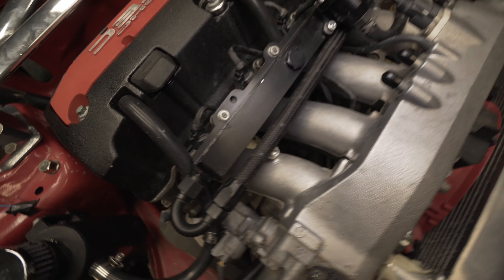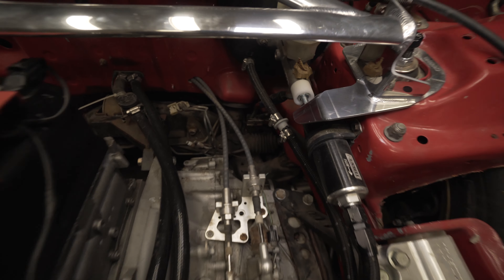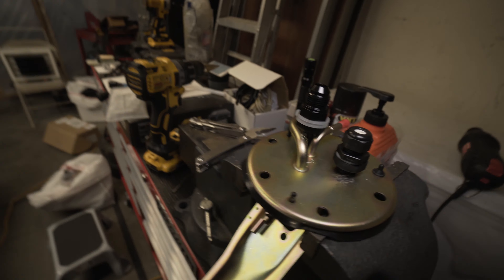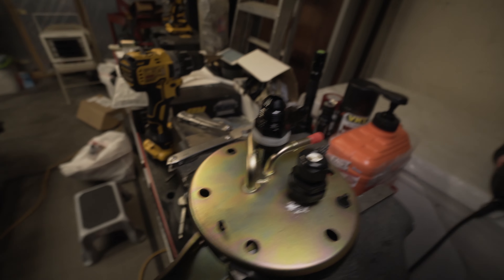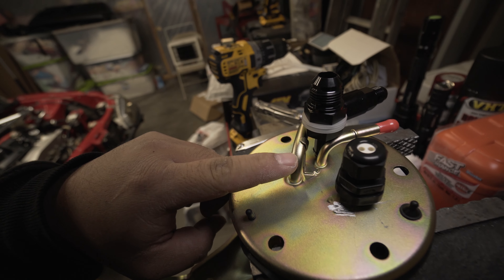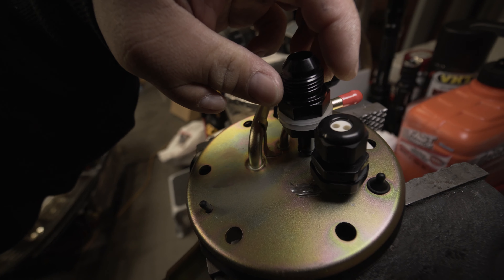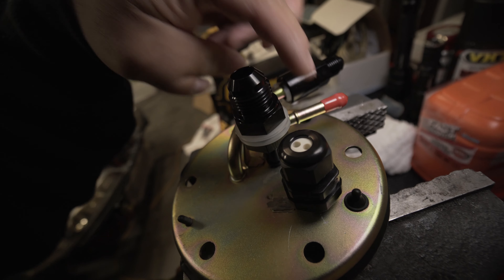This is the wiring plug that goes there, and this is the size-8 line. I'm someone who really likes to do things the right way the first time or not touch it at all. My fuel system runs on size-8 line all the way back, up until that massive fuel filter. So for me to step down would be stupid - instead of running a six to an eight with all these conversions, you start with eight and end with eight. So we've got eight and we're going to have to drill this out and put that fitting in place.